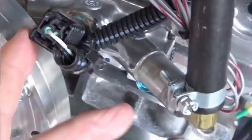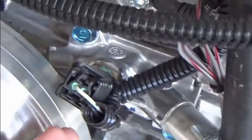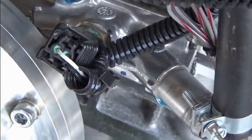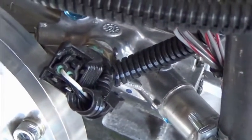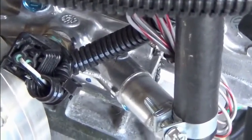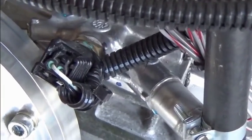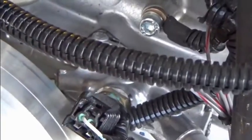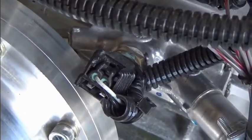It's pretty easy to do. You'll want to perhaps clamp off the heater hose to minimize the leakage of coolant radiator fluid. If you simply pop these two bolts off, it's a pretty easy install from that point on. You'll need to use the right stuff to seal it and make sure it is free of any leaks. The sender for the coolant temperature is right behind the gearbox, and removing the whole unit is much easier than trying to get your Allen wrench behind there.